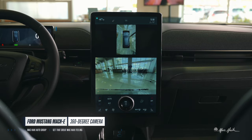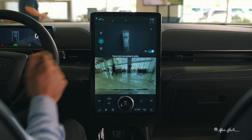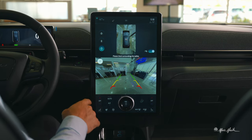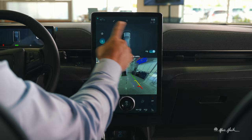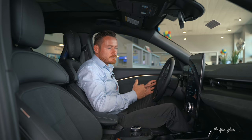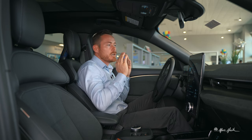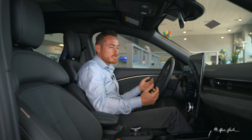Moving down, there's 360-degree camera coverage. You can see a top view, front camera only, or 180-degree view. In reverse you get the same views — 360 degrees, sweeping guidance, full reverse, sensing for nearby objects, and 180-degree. These are great camera views for parking or low-speed driving. Around five or six miles per hour the front camera turns off so it's not used for navigation at speed — using the camera on the main screen at speed can distort your perception.